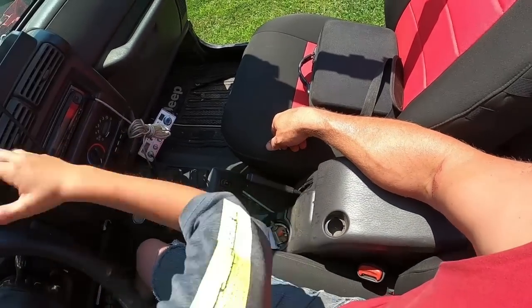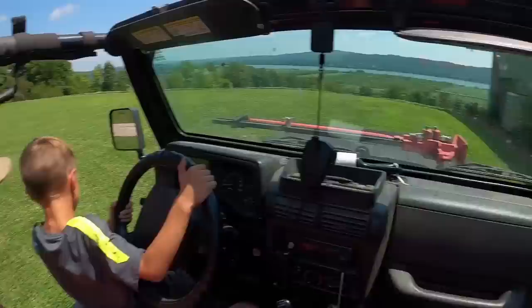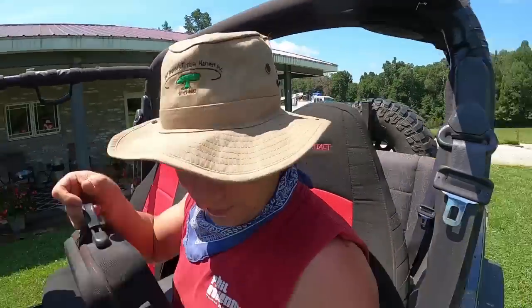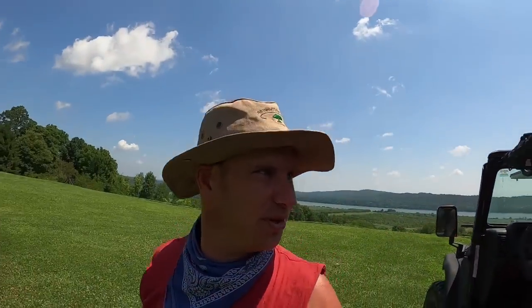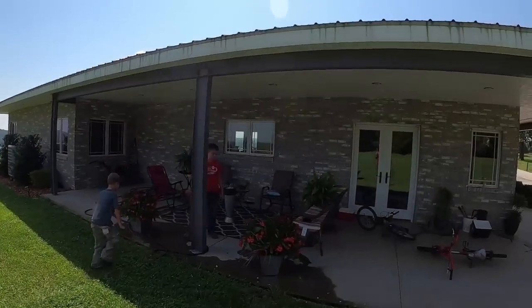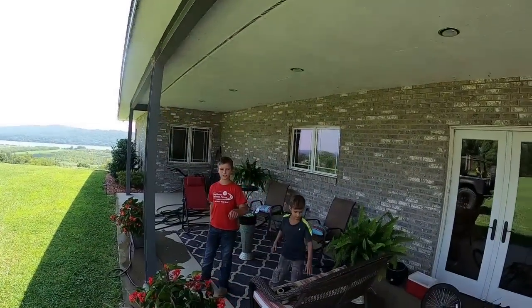Okay. I shifted the Jeep. Did you set the park brake? Yep. Okay. The yellow button. Did you pull it back out? Yep. Did it go? Yeah. Okay, that's how you know when your brake's set. That's when you release your air going back to your service brake, your emergency brakes. Put it in neutral and turn it off.